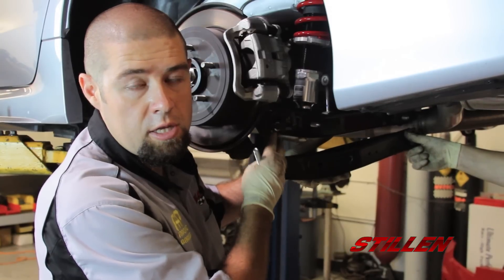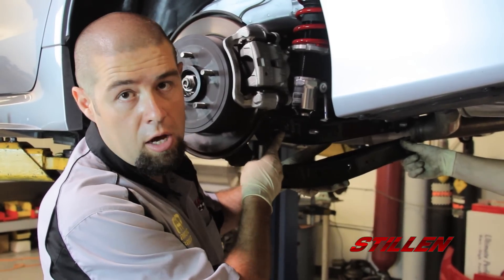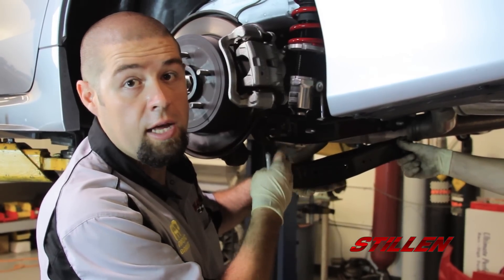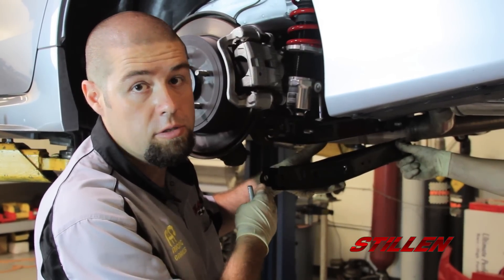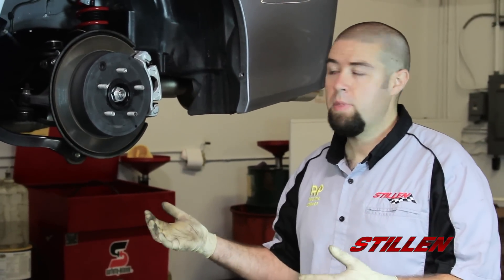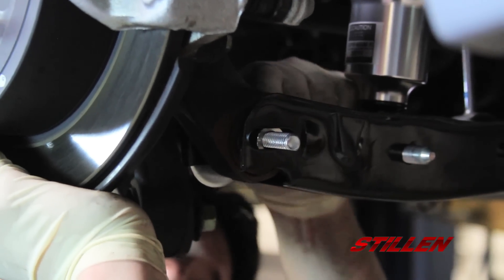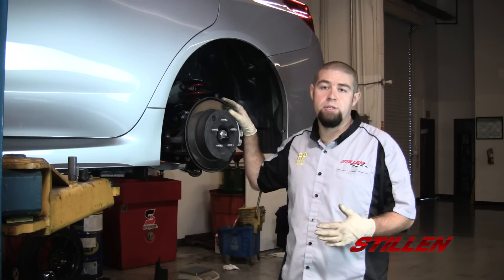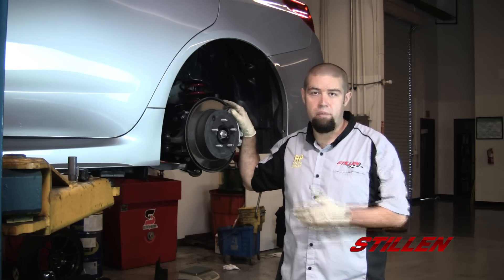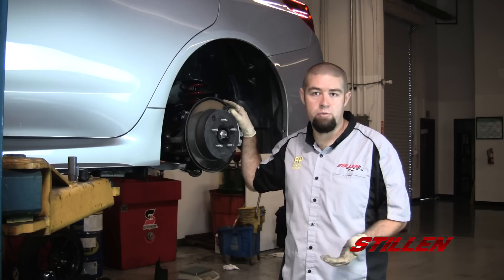Side by side, you can see that the difference between the OEM control arm and the SPC control arm is pretty big. Basically, this slot in the SPC control arm is going to give you all the adjustment that you need to dial in your camber after putting on the coilovers. Just like in the front, we're going to reuse almost all of the rear OEM hardware. The only thing that we change out is the rear gets a camber adjustable bolt. It's always key that once you complete the installation of your suspension, you want to go right through and do a complete nut and bolt check and torque spec of everything. Make sure everything's good and tight before you bolt the wheels back on and go down the road to get your alignment.